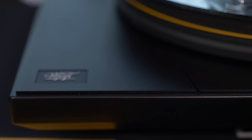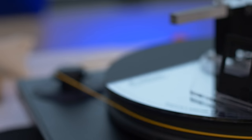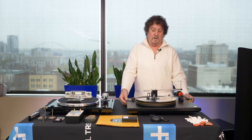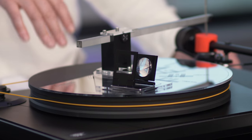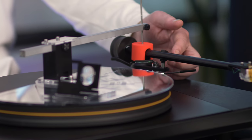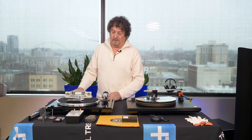This table is made by MoFi — Mobile Fidelity. MoFi does it differently to create the same effect. This is a very heavy table, twice the weight of that one, because there are composites in here. They use downward pressure mass loading, so the platter is much heavier and everything is dampened down, even into the tone arm — and both arms will have dampening.